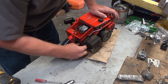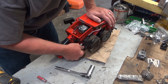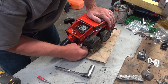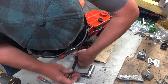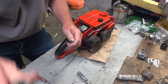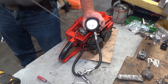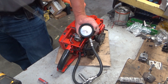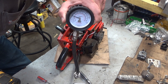Just for kicks, let's take a peek at what compression is now that it's partially warmed up. That spark plug is going to burn my fingerprints off. It's going to be lower — that's why they tell you to do compression tests cold. You've got the different expansion rates, and that's the metric the factory uses: it's a cold compression setting. 10 pulls is enough: 56 pounds of compression.